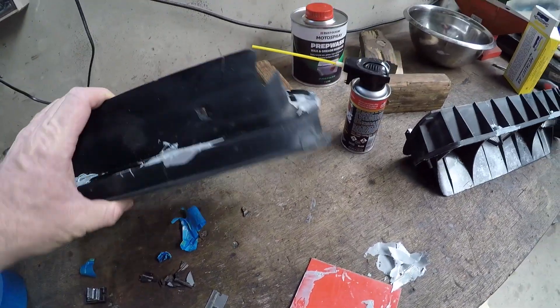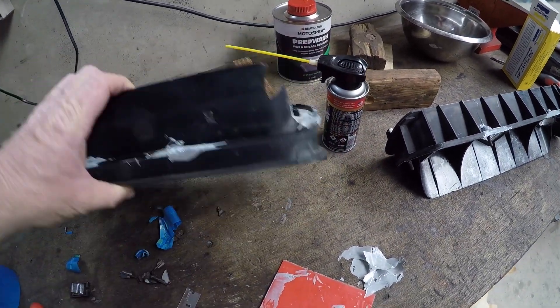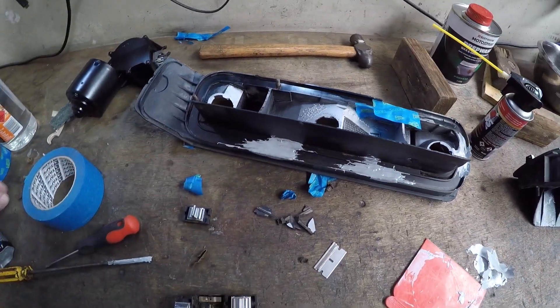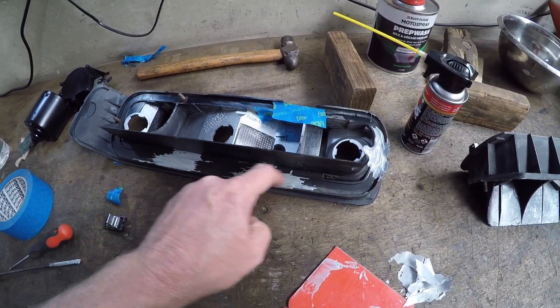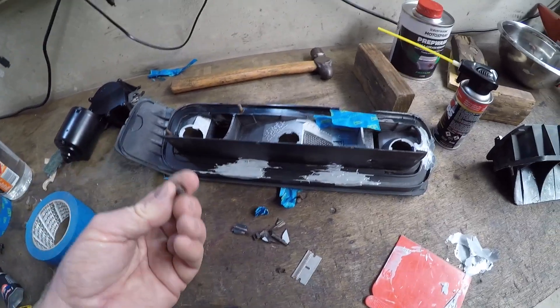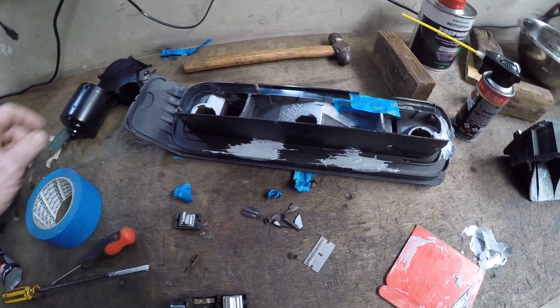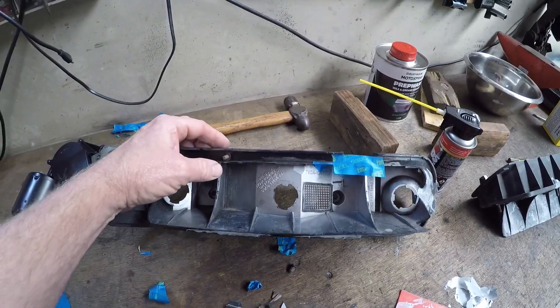You can't see them at the end of the day — as long as they're functional and in one piece, that's what we really need here. What I'm going to do where I've resined over the holes for where the studs go in: I'll just drill them back and re-resin the studs back in, then give them a clean up before we put them back. The ones already in, I'm not going to try and belt out for risk of just creating more damage.